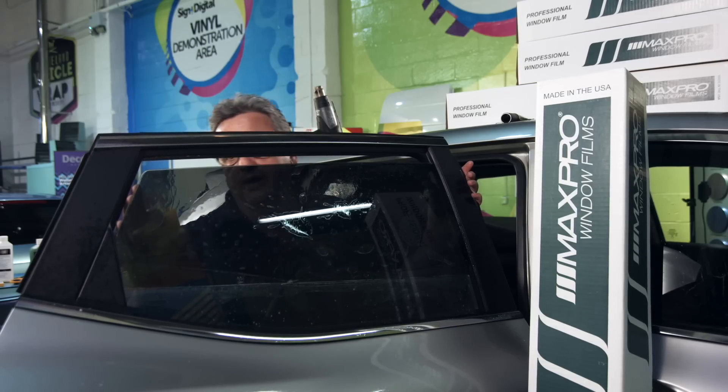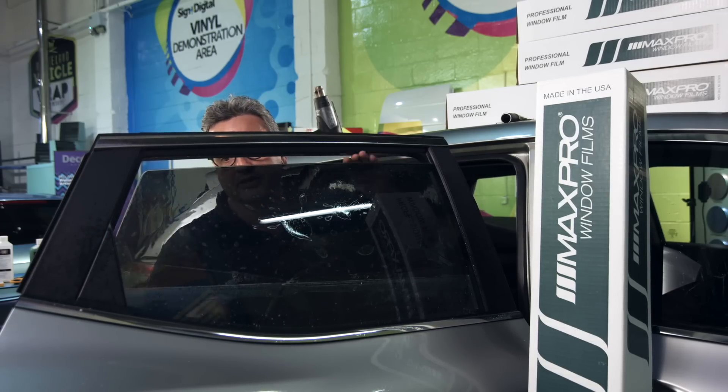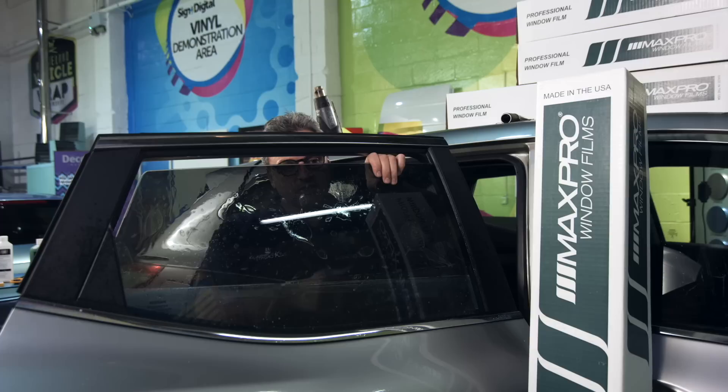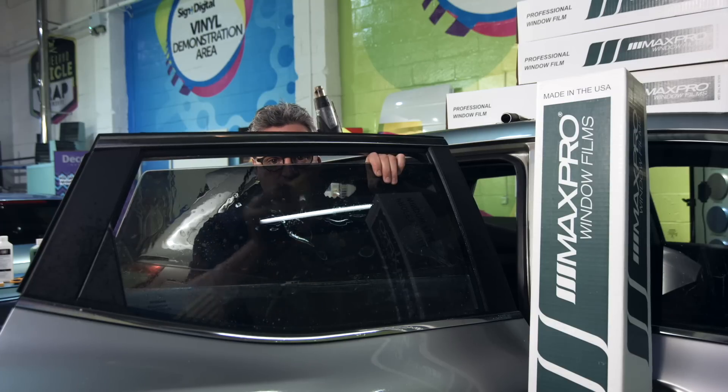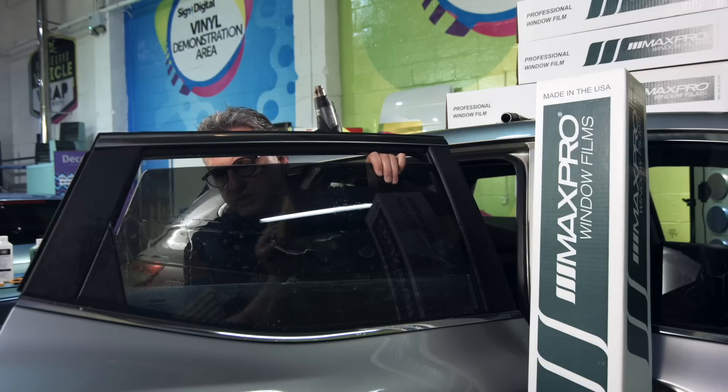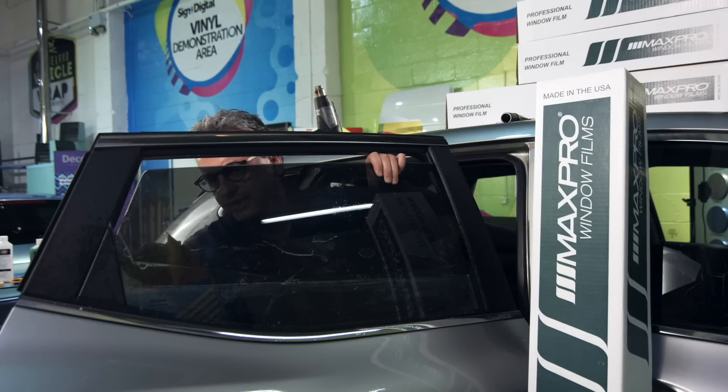Now hold it with my thumb like this. Hold it here because right now, because of the water soap, it's sliding. So just carefully in the beginning squeegee it out — not all the way down here. See here, it's moving. Sometimes I spit on my squeegee to be sure it's wet, and at the same time you can with your tongue feel if there are any scratches, which is pretty important for perfect installation. Right now I do not use a lot of pressure, that means you can still slide the film around.